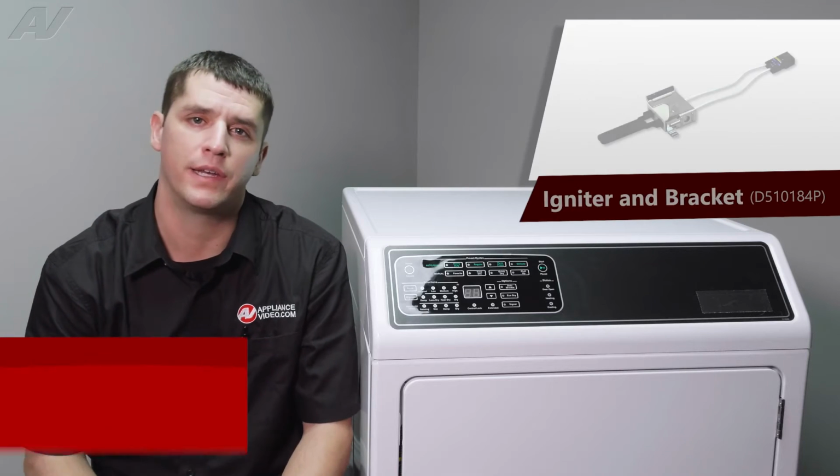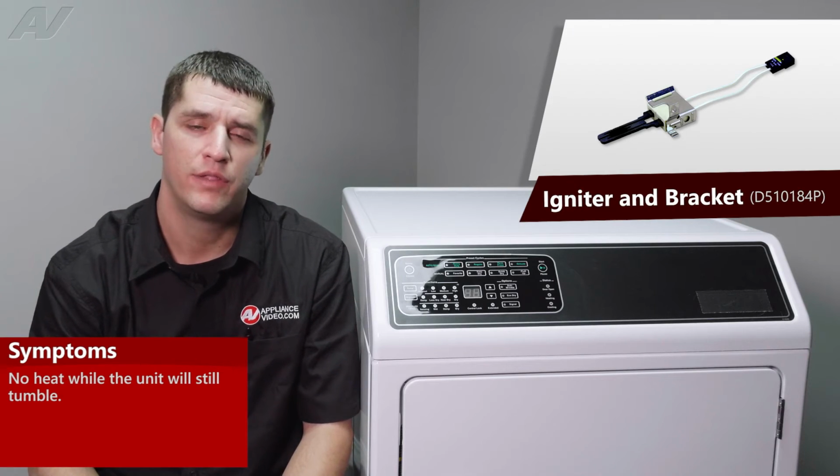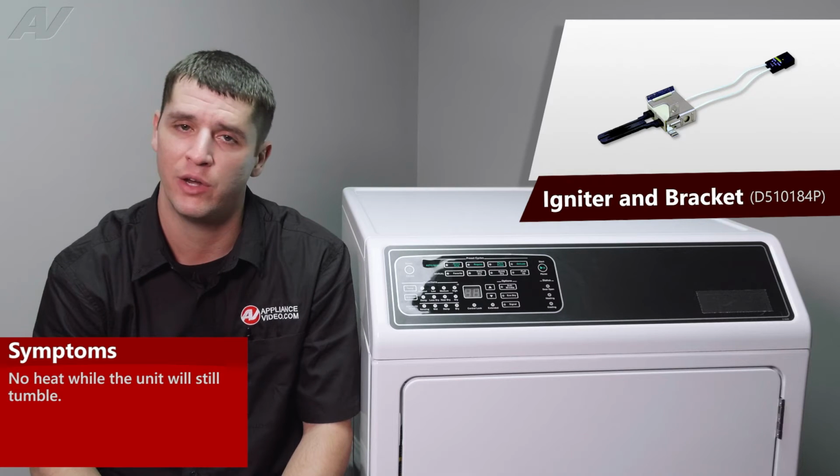Symptoms of a failing igniter will usually be no heat. The unit will still tumble, but you will get no heat.